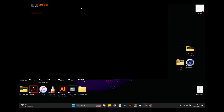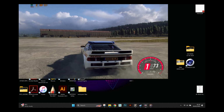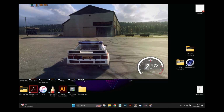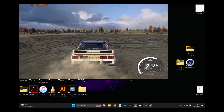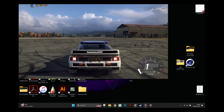And then finally, for the real world gaming performance, what we're actually monitoring is, again, the GPU and the CPU temperatures, as well as the GPU and CPU clock speeds. And what you'll actually observe with this is after 10-15 minutes, we're still maintaining a generally stable system, and we don't really have to go into undervolting or underclocking the GPU too much. And the reason for this again is because we have much more thermal headroom, because now we are actually getting very good connections with our system.